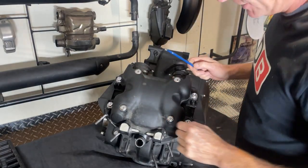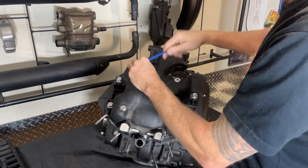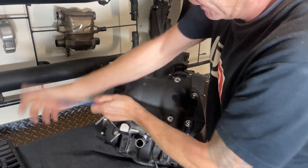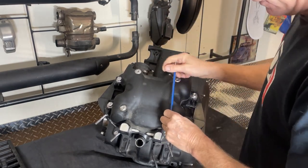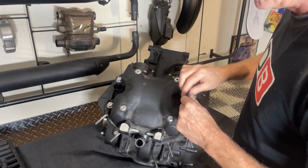We're doing it in stages like this - most of the budget at the moment has gone on the supercharger, but that has actually given the channel a real good kick up the ass so it's a good investment. First thing you need to do is take this cam cover off. A lot of people call it a tappet cover or a rocker cover, but that's not always true because there's not always rockers or tappets under it. I call it a cam cover because in this engine there is a cam under it.